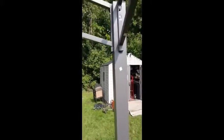Also, just an added note on those bolts, it's always a good idea to screw those in a good portion by hand first. That way they won't strip on you. But in the event they do, you can drill a small hole and put two self-tapping screws in, such as what I did here.